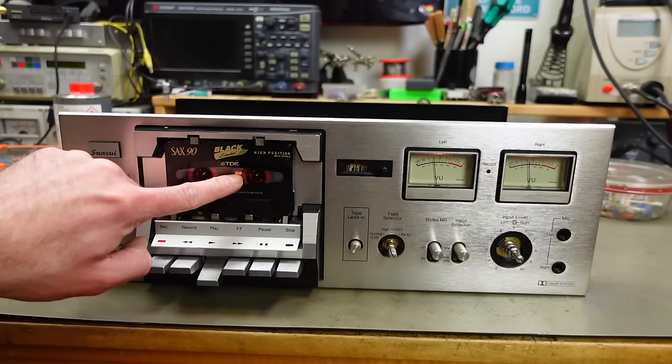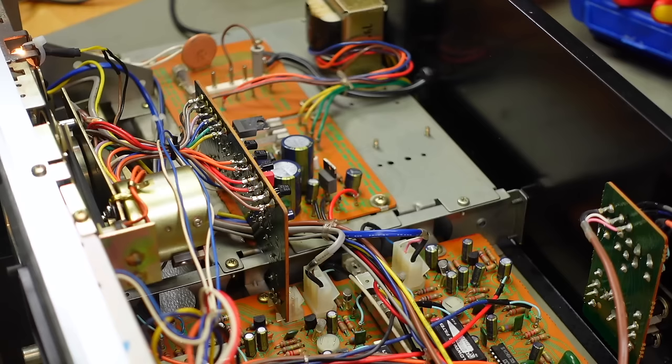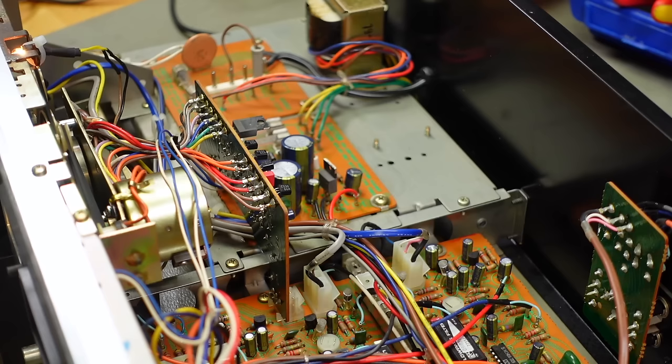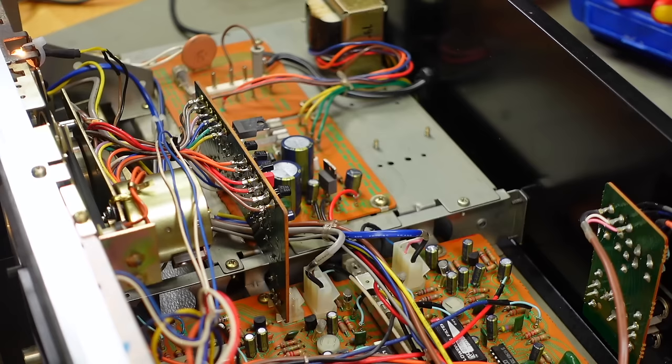The light behind the tape is actually quite useful — you can see the tape advancing much better with the light shining behind it. I'm also going to put some hot glue on the larger caps where there was glue originally, because the motor is right next to them. For the lubricants used: fine machine oil for metal bearings like the capstan and motor — essentially a generic fine mechanic oil for sewing machines — silicone lubricant for plastic on metal or plastic on plastic parts like pulleys, and silicone grease for mechanical parts that move up and down.